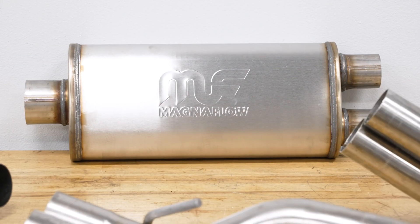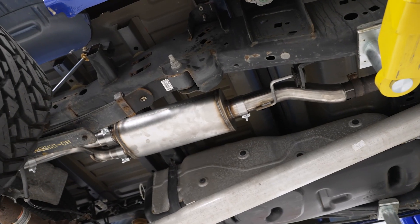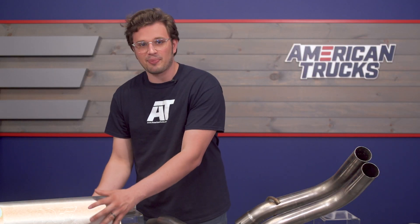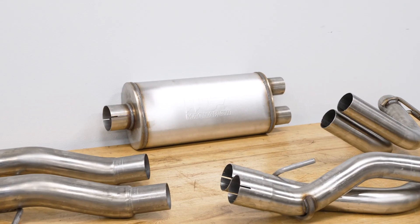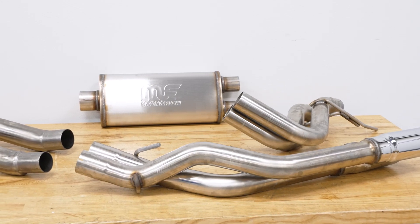The muffler here is a high flow muffler, which means the air can move freely right through that chamber and it's going to silence some of the noise and take the edge off even though it's pretty much straight through. Air can pass through the core and it's actually silenced by the packing around the outside of the canister. This muffler is also going to function as the Y pipe and it's going to even out and smooth that sound and equalize everything between the two pipes.